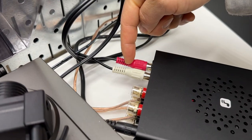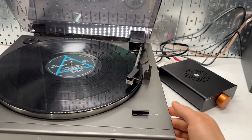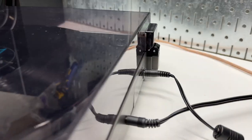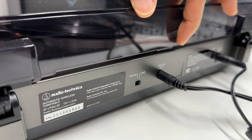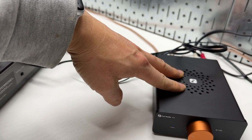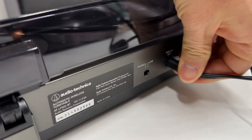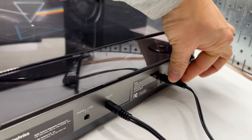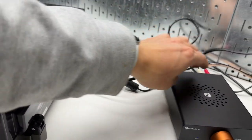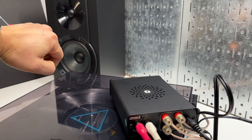The input goes in here — that's the line out from the Audio-Technica turntable. Keep in mind I'm using the phono and line selection set to line. If you use the phono setting, the volume will be very low, so it's not appropriate unless you have a phono preamp — that's more like an equalizer or decoder. The analog audio out is a 3.5mm jack, with no RCA connection. There's also the power supply in the back, and I'm using a 3.5mm to RCA cable to connect to the amplifier, then two sets of speaker outputs to the Sony bookshelf speakers.